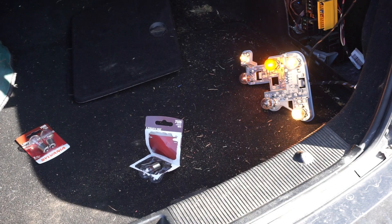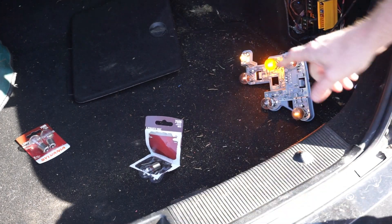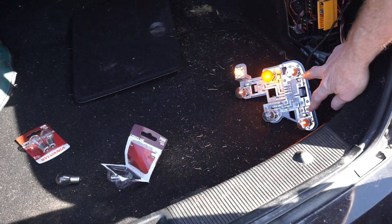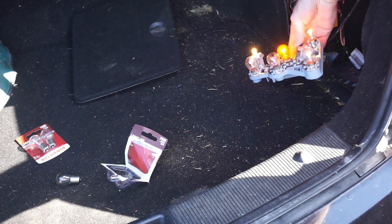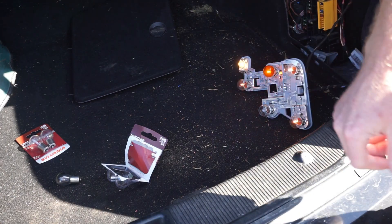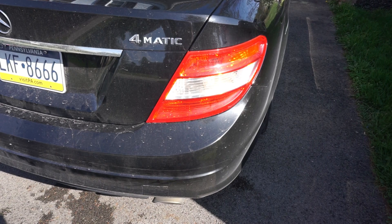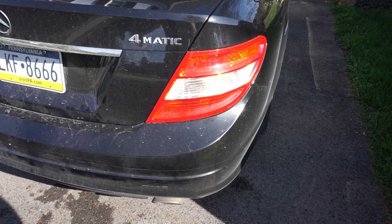We're good with that. When she lets go of the brakes those two went dim — that one stays dim all the time, I don't know what's up with that. Put a new one in here. So these are the two brake lights that I put new bulbs in. Everything else is working. Let me clip that back in.